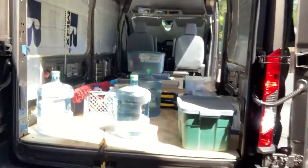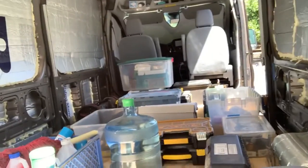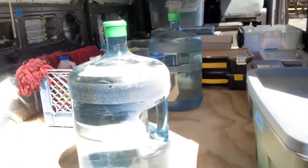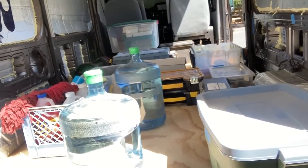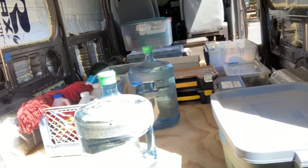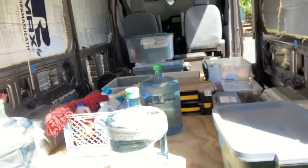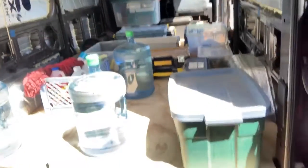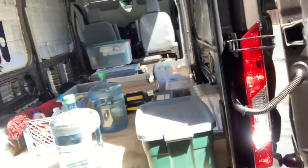Last thing: here's what's going on with the van. This is the subfloor drying right now — I'm not going on a trip. I cut up a bunch of 3/8-inch plywood and made battens that I glued to the floor of the van. Those are strips of plywood fitted in between the little humps on the van floor, and I'm going to screw the subfloor into them. Not very exciting, but it needs to be done. Glad I finished — good to see you, talk to you later!